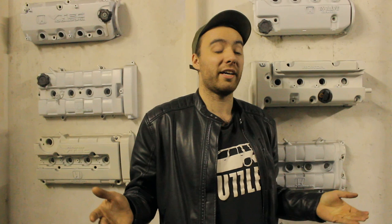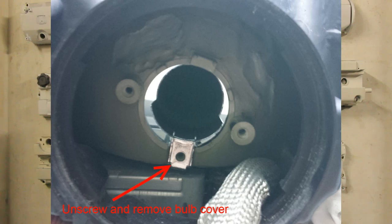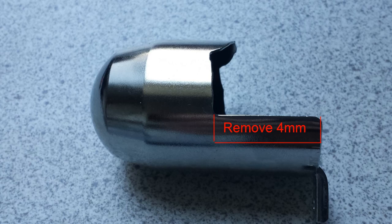Next up, we have headlights that have a bulb cover. Basically, light shines out to a bulb cover, which reflects onto the headlight itself, which then reflects outwards. A good example is an R34 Skyline. The user Falsk on Skyline Owners posted high quality pictures of the bulb covers — I've linked it in the description. As you can see, one side of the bulb cover is taller than the other. You need to add a little material on the shorter side to get a flat beam, or remove a couple of millimeters on the other side to get a fully legal left-hand drive beam in Holland.